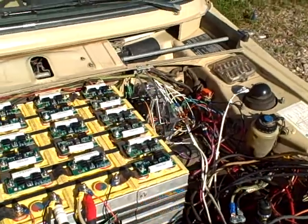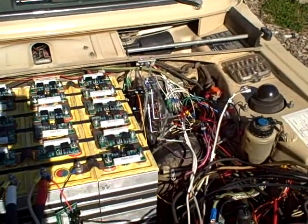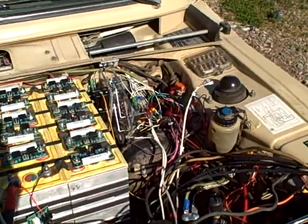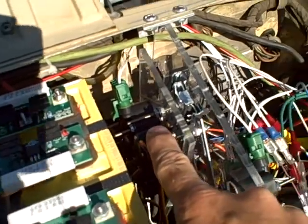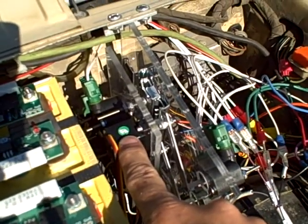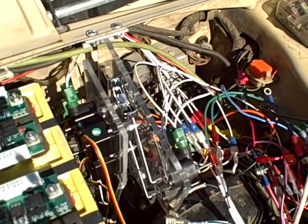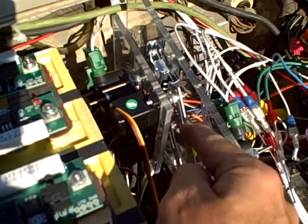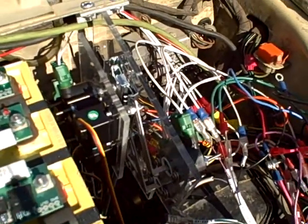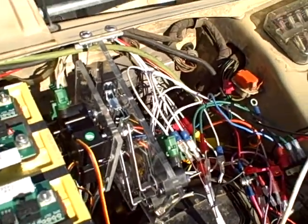Since I now have four motors and no differentials, I wanted to be able to directly control the current flowing to each motor and balance it side to side. I hooked up the potentiometer via its arm, but it's also connected to a remote control servo. That servo connects to a microcontroller that measures the current going into each motor on either side. The servo can then change position and vary the throttle without moving the accelerator pedal — the computer measures the current to both motors and decides to back off on one and accelerate the other to balance the current between them.